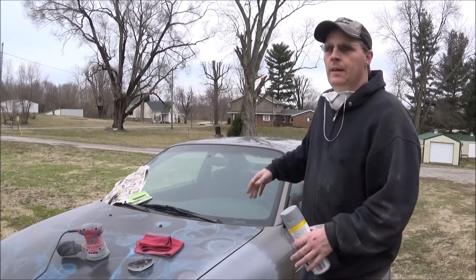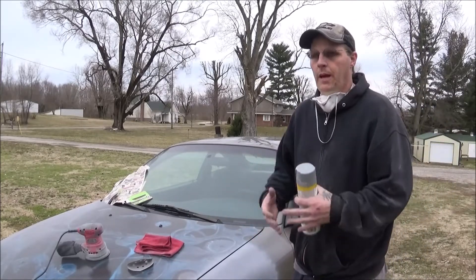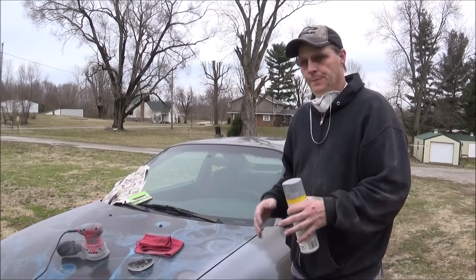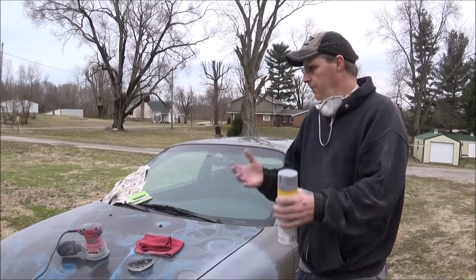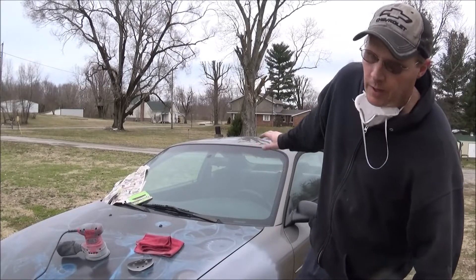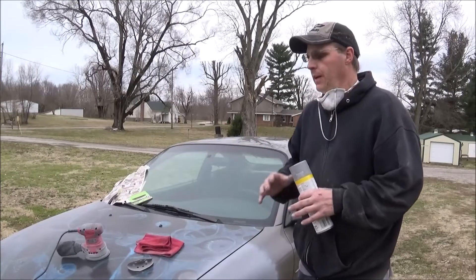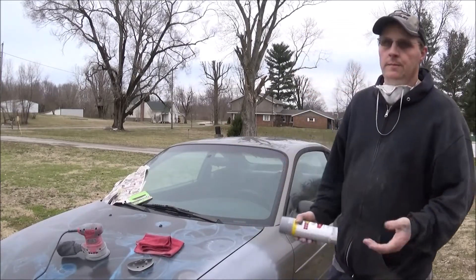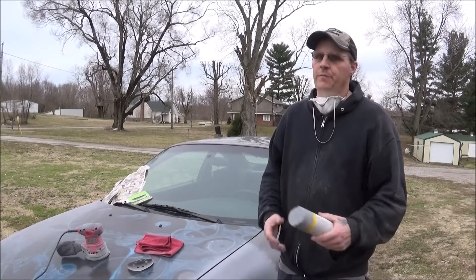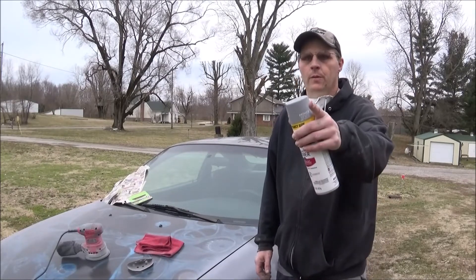I see it time and time again — people change the color on the outside of the car and leave their door jams and under the trunk the original color. So instead of it just taking one quart to paint it, it would take two maybe three quarts because you want to do underneath the trunk, underneath the hood, maybe inside the trunk a little bit, so that it's at least hidden — and you want to do the door jams. That's at least how I would do it. That's one of the reasons I'm thinking about going ahead and keeping it the stock color, that way I don't have to fight with the door jams. I could still kind of use my theme — just do it like gray and black or whatever colors I decide to use. I'm probably not going to airbrush anything; if I do, it's probably going to be really small and not even on the hood. Anyways, that's going to be it for this video — appreciate you guys watching, feel free to subscribe, hit the notifications, and have a spectacular day or night, whichever one it is for you. Peace out.